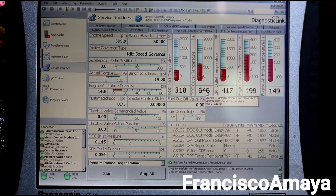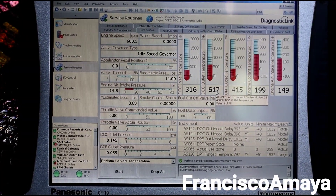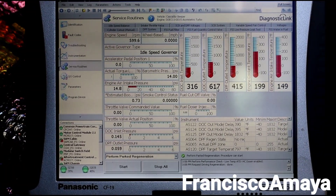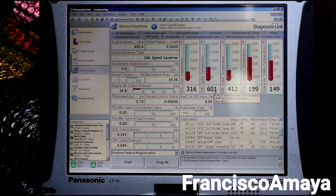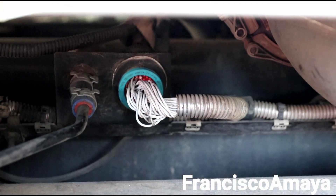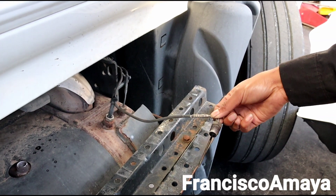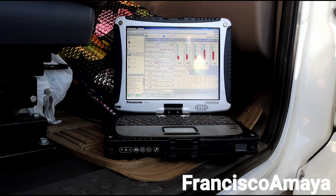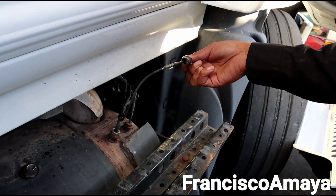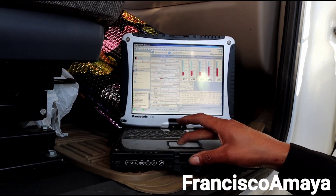The sensor going bad is a very easy thing to identify. I'm showing you how to inspect if the sensor is bad — you have to remove it and that will confirm it. Once you see this, it's easy to know how to inspect the sensor. In some cases, the wiring harness is the one that's bad. But in this case, that is not the issue because we can clearly see the problem is the sensor, since it is still reading 500 degrees even without any temperature and even with the sensor removed from the SCR box.